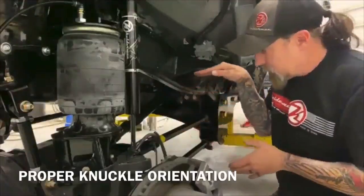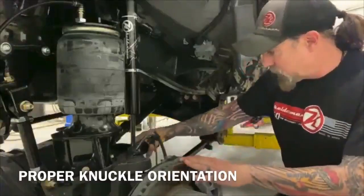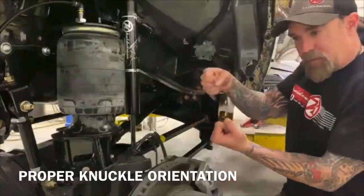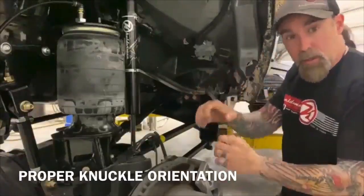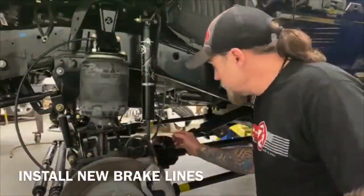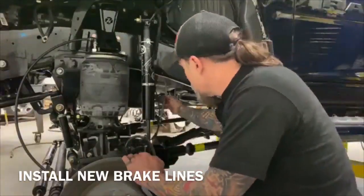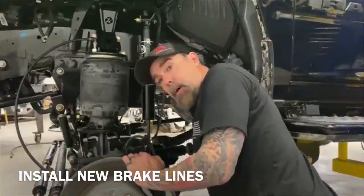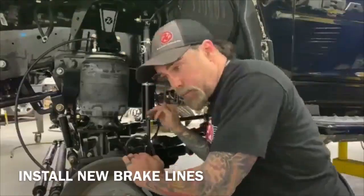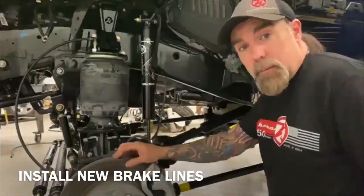One thing on these Dodges: you've got to make sure these are offset correctly. The gussets go toward the center of the truck, so the top and bottom corners of where these thread in are facing the tire and spread out farther. If you get them flipped around and they're close together, you'll get a lot of rocking action, and we definitely don't want that. This kit also comes with longer brake lines. The bottom end just fastens right here on top of the axle like the factory one. On the passenger side — the turbo side — you'll see there's some plastic reflective material for heat. Make sure you reuse that so we don't get that brake line too hot and melt it.